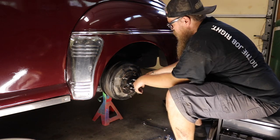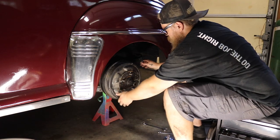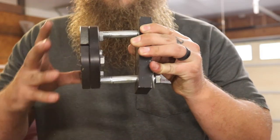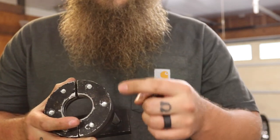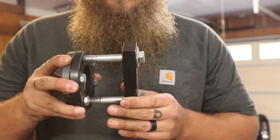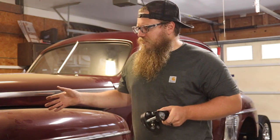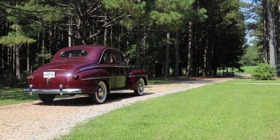There we go. I'm going to go ahead and take the tool off since I don't need it anymore. That's how you get the drums off for early Ford. On this tool I've had to put little spacers in so the bolts don't go all the way through and hit the hub — sometimes the bolts are too long on this setup — but this pulls it off every time. Obviously there are always ones that are harder than others. This car came off like butter; it's a nice running driving car, and this is what you should expect.